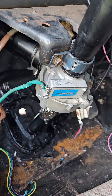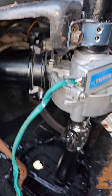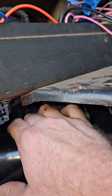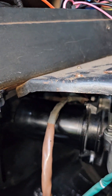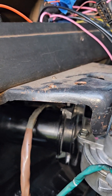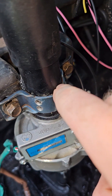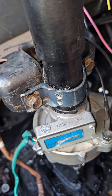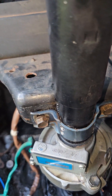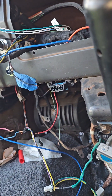I've got the Prius electric power steering in — there's the coupler and the original inline shaft right here. All I've got to do is come up with a bracket to secure it so the motor doesn't turn on me when I go to turn. I might instead run a weld right here — I could do it while it's in the vehicle, it's not going to hurt anything. That would be the easiest way to keep it from rotating without installing an actual bracket, but I haven't determined what I'm going to do yet.